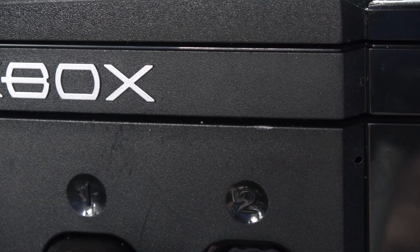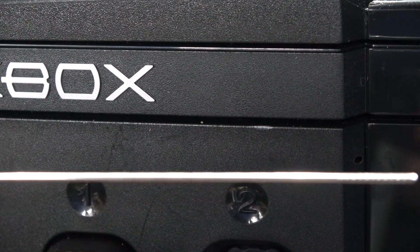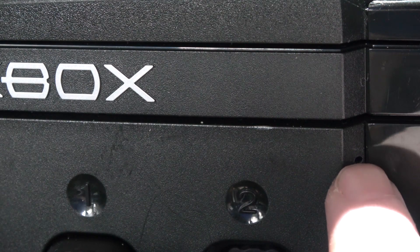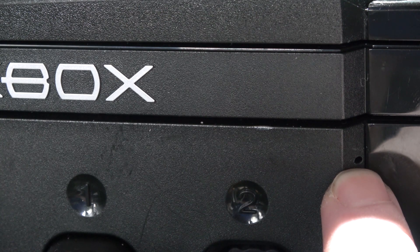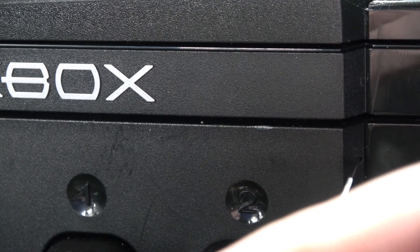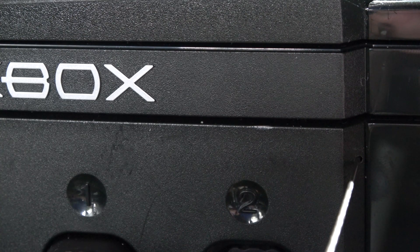The problem with this Xbox is a very common one, especially if you have a Samsung drive — they're more notorious for doing this. I'm going to take my adapter that I use to clean the nozzle on my desoldering gun. If you look to the right at the bottom of the Xbox you'll see a little hole — this is the manual eject for the drive. The tip here is to press eject on the Xbox and push at the same time, and the drawer will come out.